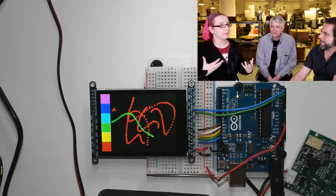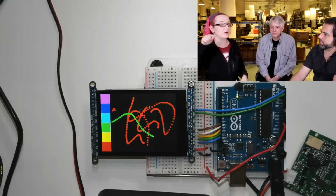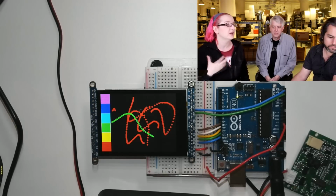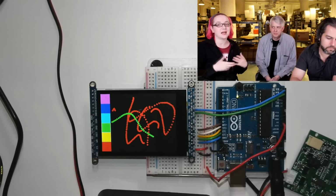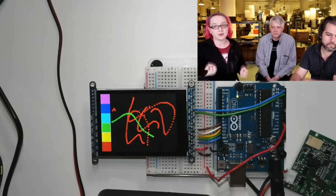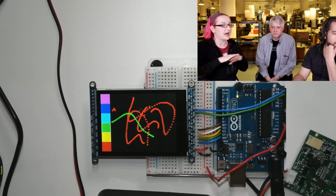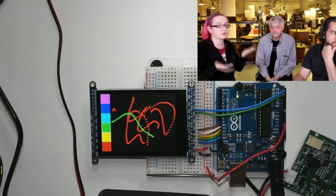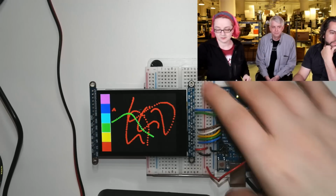What people like about capacitive is that you don't have to push on it. You can just glide your finger over. So it's a much nicer feel. Also, you never have to calibrate it, because the calibration is fixed, so it never goes out of calibration like resistive does, and also looks better. It looks much clearer because it's just this glass covering instead of the resistive covering. But it's more expensive, so there are trade-offs. All right, we're on our journey with new products here.